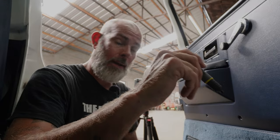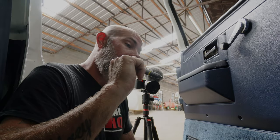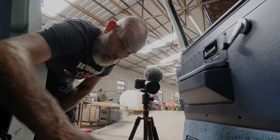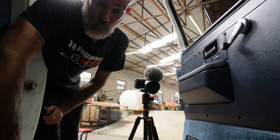First thing first — I'm going to make a couple of marks where I need to work. I'm not going to grind, I'm going to use a scotch brite wheel because grinding takes away metal and I don't want to remove any material I don't have to. I'm just going to mark a couple spots with the Sharpie Pro. Then we're going to pull this piece off, clean our material up, glue it on, clamp it, and wait 24 hours for the glue to dry.